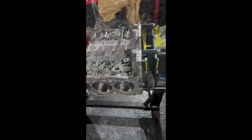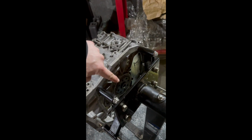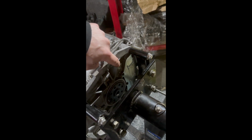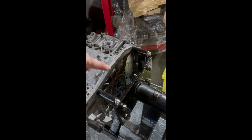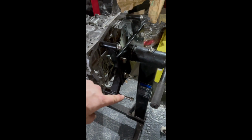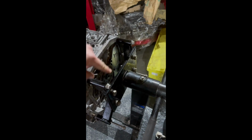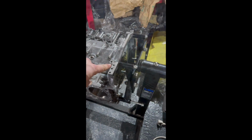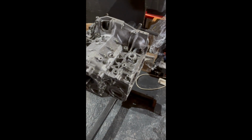So as you can see, we've got the engine on the stand. We've got the rear main seal in. We've got some block plugs, oil galleries. We've got the inspection port for the piston pin covered with one of the circular plugs, and then the plate on and the EU sealant on that. Actually, some spare water jacket bolts, a perfect size, just go through into the gearbox bell housing area to secure it to the engine stand.